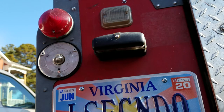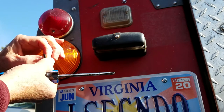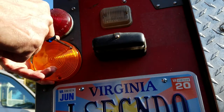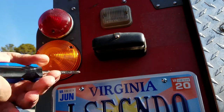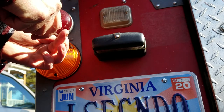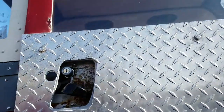So I'm going to put on this aftermarket lens, which I'm just hoping will not fade like I've seen on so many cars that have an aftermarket lens put on — they never really match the original. I'm keeping the old one just in case this thing fades. I think one of the problems with these is the temptation to screw them in too tightly, and that's what cracks them, so I'm being very conservative on the tightness. These are nice black screws — they look pretty good.